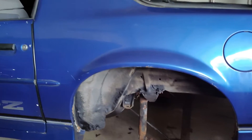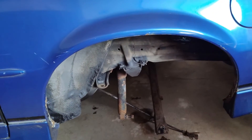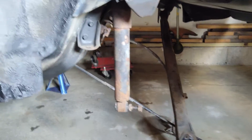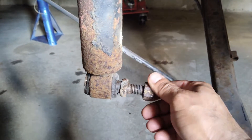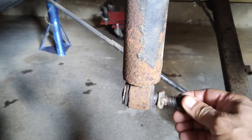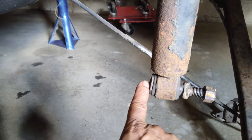Welcome back to the channel. This is the third gen Camaro and I'm going to show you how to remove the rear shocks. I already have the rear axle completely out of the vehicle — shocks are still there. I have the bottom bolts out; these are 21 millimeters. These are the first ones you want to undo — either way it doesn't matter, you can do them from up top. These are 21 millimeters, and these have a bolt that goes through them.